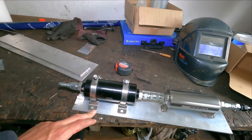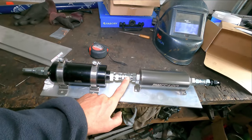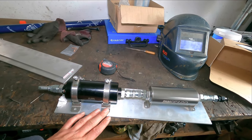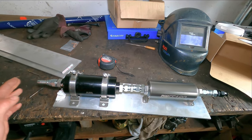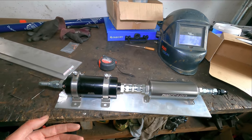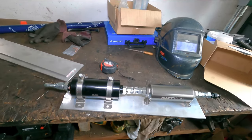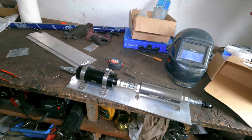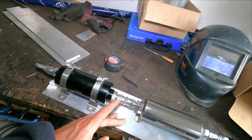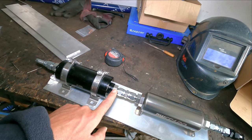I think this is just the easier way to do it. Because if you want to change the fuel filter, you can just remove the coupling here and over here and remove it without getting the whole system out of the car. I also changed the aluminium connections that I first had for just steel galvanized, straight hydraulic connections.